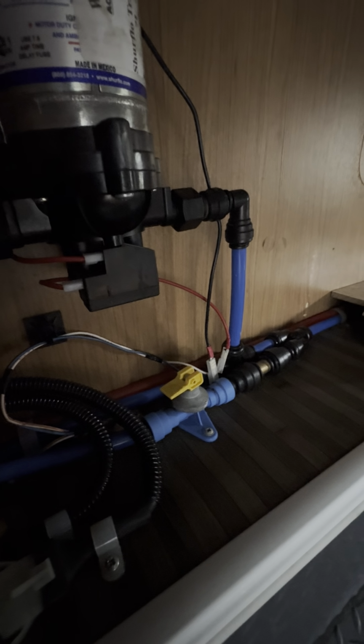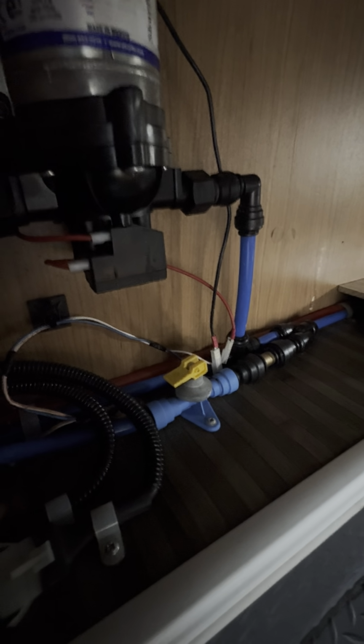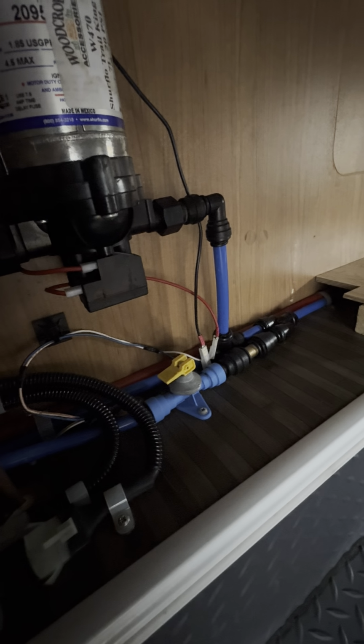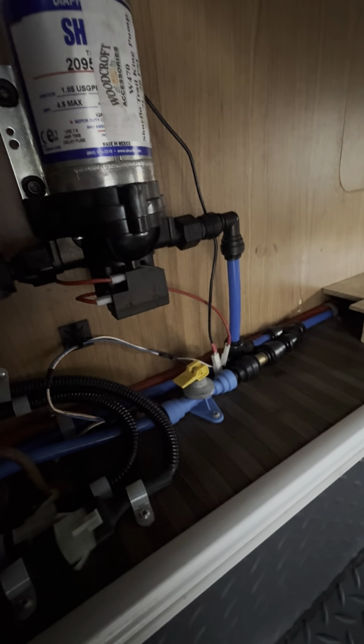if it was coming up to winter and you wanted to winterize the vehicle, you would lift that up, drain all the water out of the boiler, do the same for your fresh and wastewater tanks as well. But yeah, it's just a good way to stop any water from freezing up inside these pipes, and obviously the boiler itself as well. So that's your boiler drain-off point there.